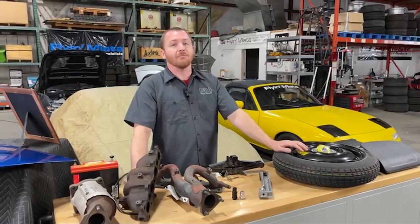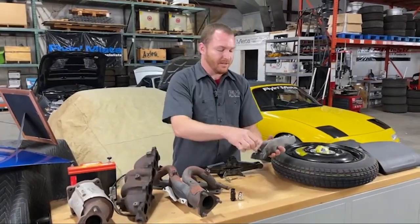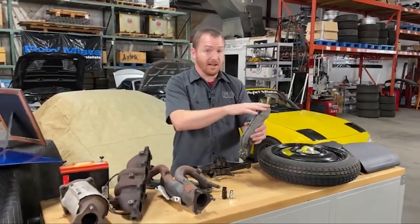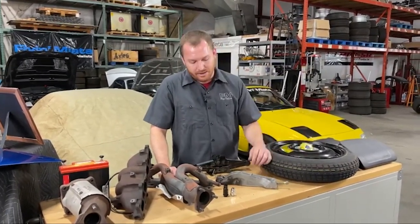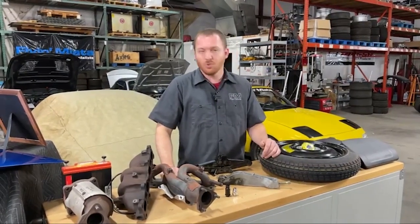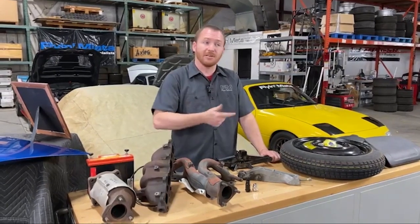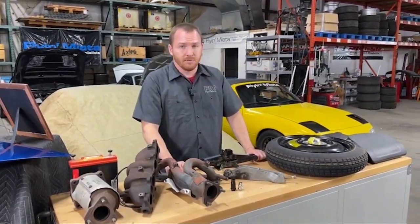Another one that is very common, that I recommend all the time for NA and NB owners, is just get rid of the intake manifold brace. This little brace is supposed to brace up your intake manifold — it bolts to your block and into your intake manifold on top. Mazda thought maybe their intake manifolds would be so floppy that they'd come off if you hit a big bump. That's simply not the case. I've had mine removed. Everybody here has had theirs removed for years. You need to loosen it to change your belt, and you also get better access to your oil filter — you can actually reach it from the top after removing this brace. So it is good for weight savings, but mostly just for ease of use and access to your engine.